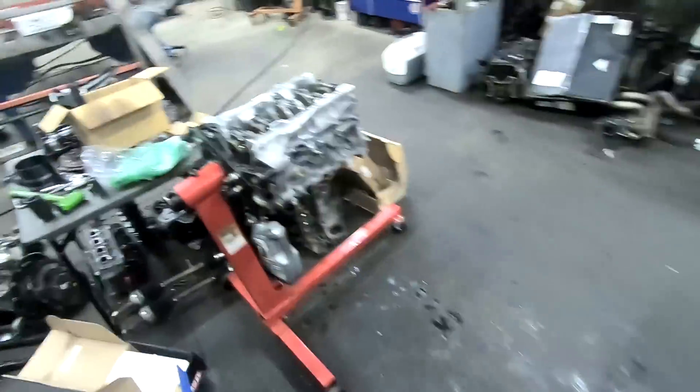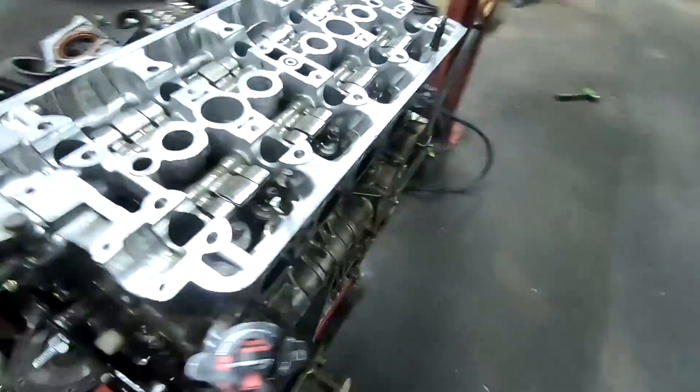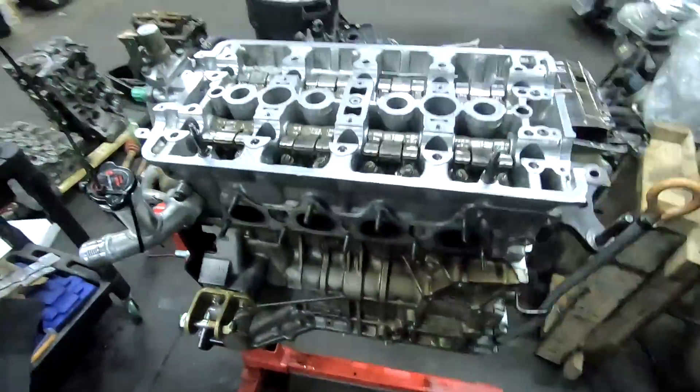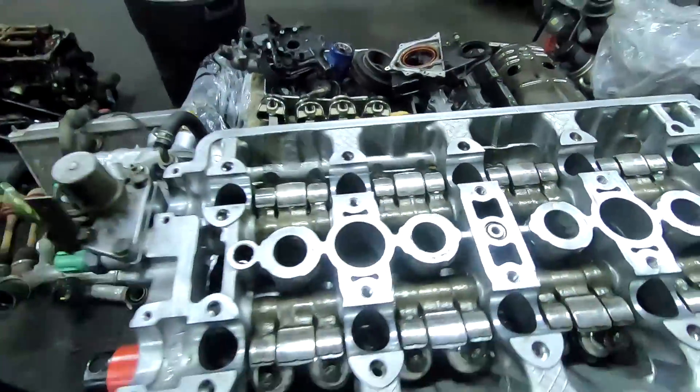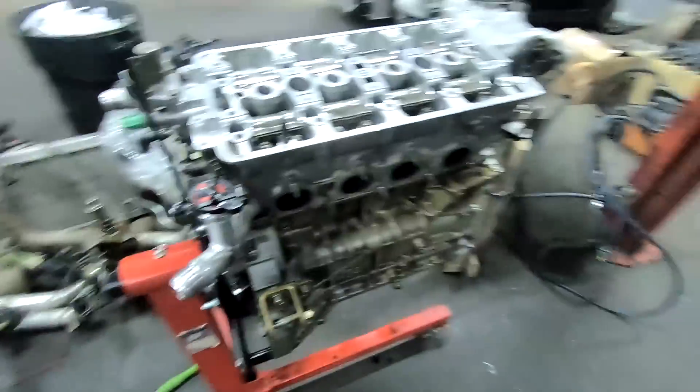I think I'm gonna drop the head on this one now and then get back onto the LSV-tech once that's all torqued and fully long-blocked. Got the head on there now - need to put all the nuts and washers on it, torque it down, it's gonna be epic. Heads all on Mario's now, torqued down, got the thermostat on it tight, good O-ring in there. Things coming together really well - everything's almost there on the front. Just need to change out these rockers, get the cams in it, time it up, valve lash it. The valve lash definitely needed some adjustment last time it was put together.